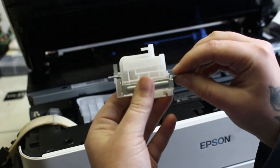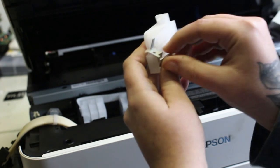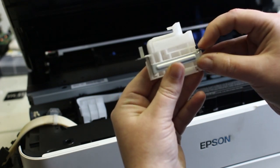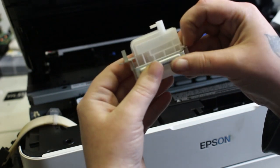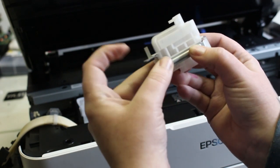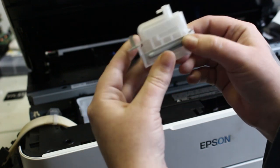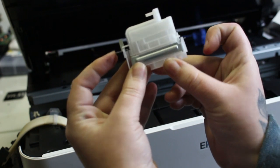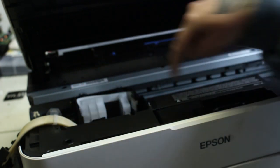That makes sense. If we turn the damper over to what we'll call the rough side, the part where we can't see our ink directly, that's the part where we line up the bracket and try to snap it in. You're going to push, but you also want to make sure that it's lined up. Sometimes you hear it click in, other times it just fits in a little bit, but the way that I test to make sure it's fully in there is either I'll hear it snap, or I won't be able to push it in any farther. Then I should be able to push it back and forth and see the little tail in the back push in and push out like I'm doing here. That's always my test to make sure that I have the bracket on that damper fully.